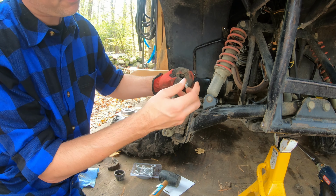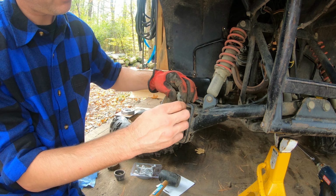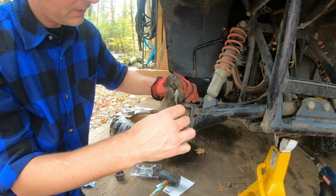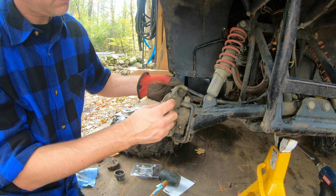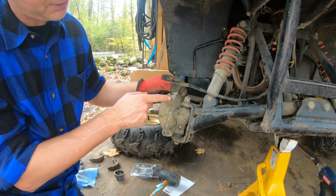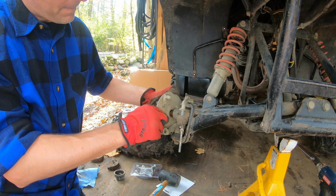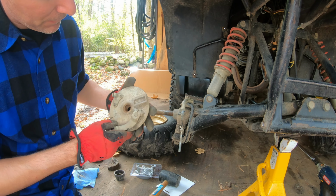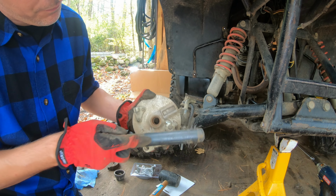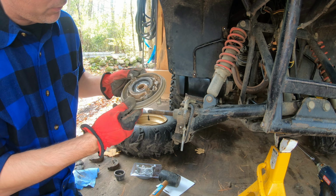I can take the spring off by slipping this little cut washer. I'm gonna get the spring down because I want to make sure that I have this rubber boot up there to protect all of that. I'll leave this off, make it easier to put all of this back on, get that E-clip in there without fighting the spring when I'm done. Oh, look, you can kind of see that looks like there is a wear indicator. Yeah. Look at that. All right, we'll go clean this up.